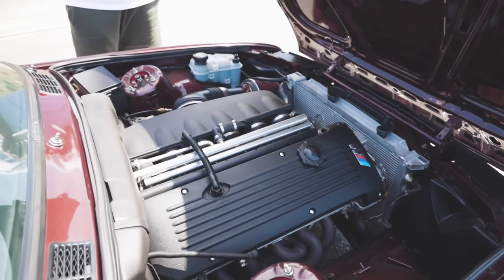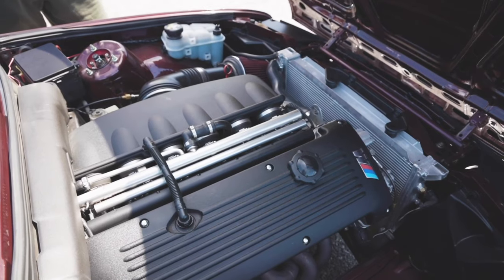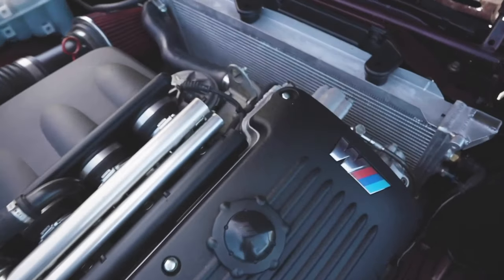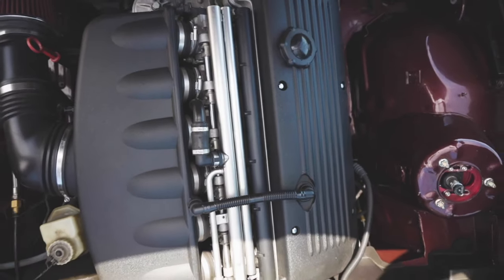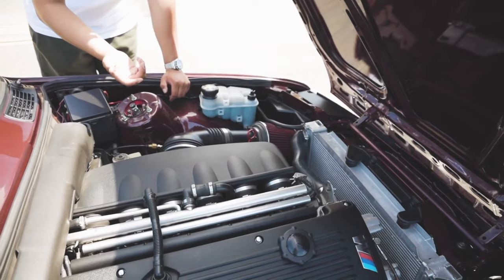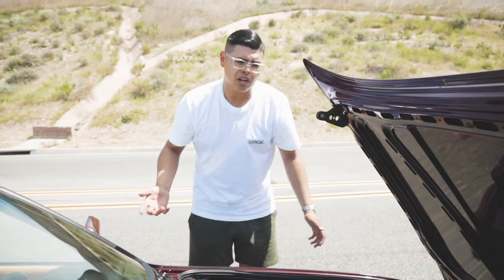This is a 2005 E46 M3 motor. I originally bought it from a guy who said the rod bearings were done, but in reality they were never done, so I got some money back and had the motor redone. I recently got the head redone as well — the previous swap had some misfires so that had to be fixed. The Euro engine bay has no power steering and uses an original no-power-steering rack, which makes it a lot easier. This car also does not have AC.